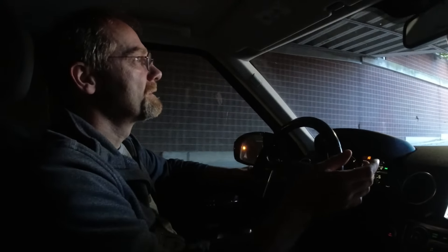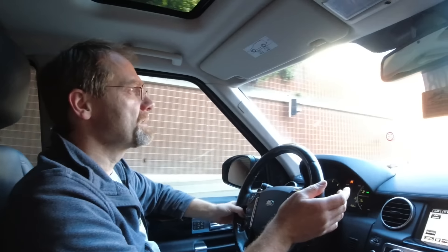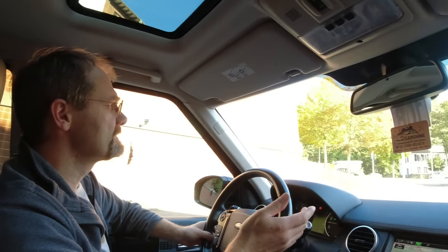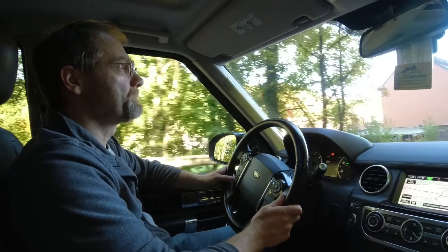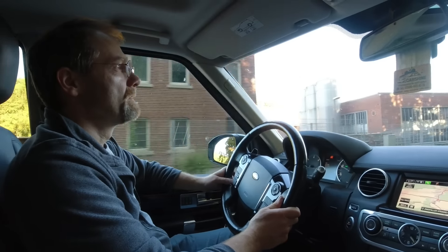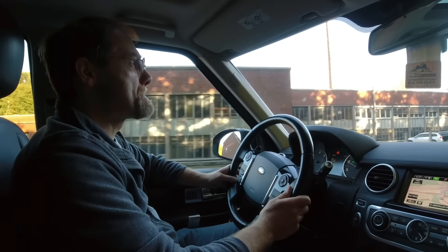The sensor might be missing or the wiring is messed up because they replaced the windshield — and the windshield does look kind of new. The eco mode is not working. And this car has 20-inch wheels.